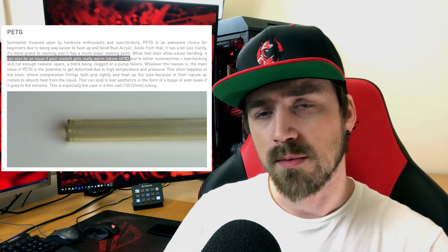I was a bit shocked that PETG tubing deforms inside the compression fittings. I've never seen that before and my GPU loop never runs higher than probably 50 degrees Celsius. But according to the EK Water Blocks blog, what they're saying is that PETG can deform if the temperatures are running above 40 degrees Celsius. So what temperatures are safe for PETG tubing? To be honest, I do not have an answer to this question, but I intend to find out probably in the next video.